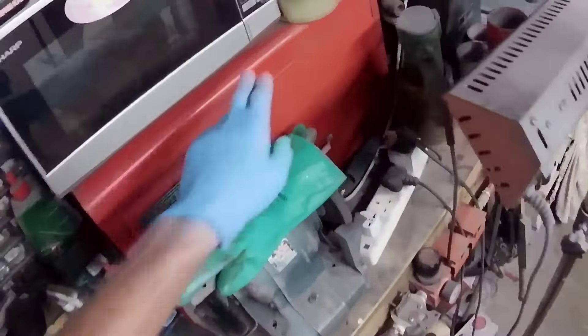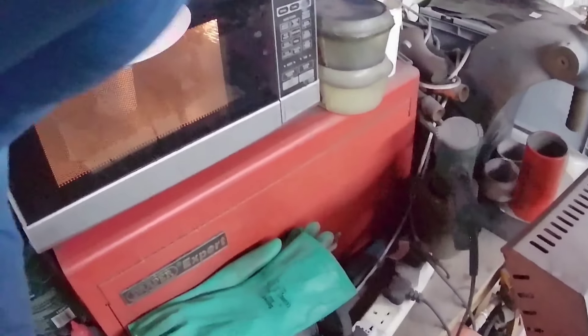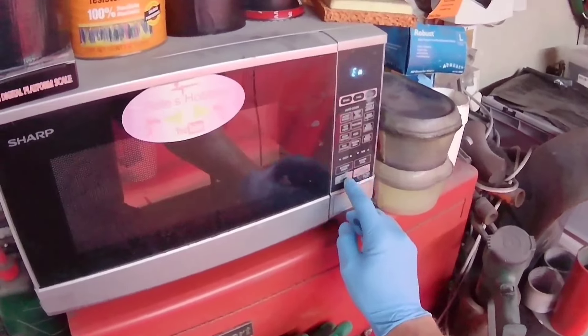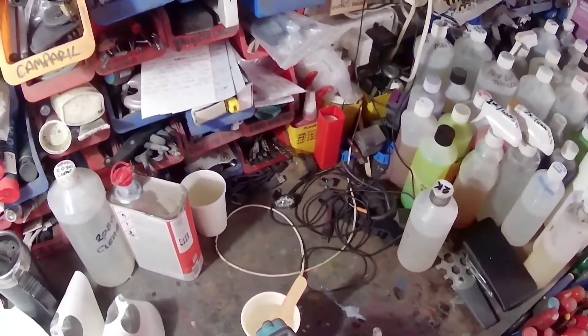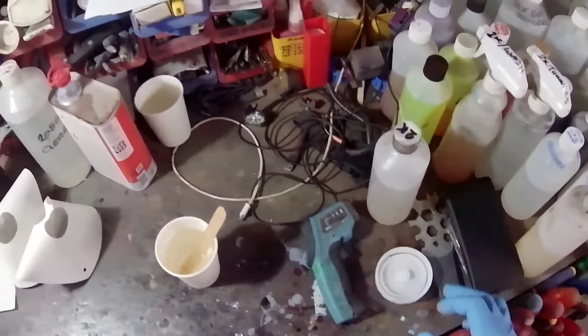You'll see me using a microwave — apologies to regular viewers — but I'll put a disclaimer: you shouldn't really do this, but I do 10 seconds per 100 milliliters. It obviously depends on ambient temperature, but I find it works absolutely fine. It helps the clear coat run out better. I'll put a link in the description to a video I did about four years ago showing how warming the clear actually changes the viscosity, makes it flow much better, and because the material is warmer it goes off faster, helping you avoid dust nibs.